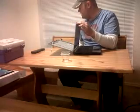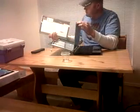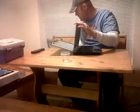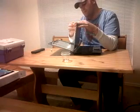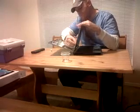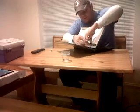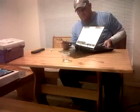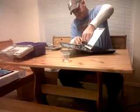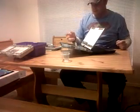As you can see on this new screen, it doesn't have all of this stuff here — that is because this is the connection to the web camera. I just want to real gently take this loose. There is a little piece of tape here; just get that little tape off of there. You want to be real gentle with these — they are very small wires, very delicate. Remove that piece of plastic and that frees that connection there as well.